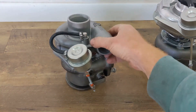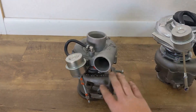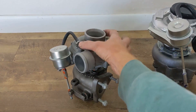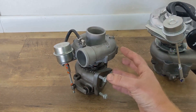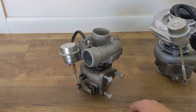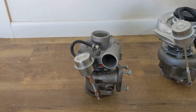Visually it looks exactly the same and that's the benefit. Other companies offer hybrid turbos but they usually have a different compressor housing — they get the exhaust housing and put a different compressor housing on it, which means you need a different air filter connection and usually a different intercooler or output connection. I wanted something straightforward: take off your old turbo, put this one on, and be done. You get to keep the stock Mercedes air filter, which is better than any aftermarket. If you're running it on a swap without a computer it'll run great, and in the W210 with Sean Tracy's stage 2 ECU it's still gonna run great.